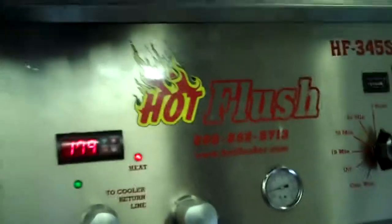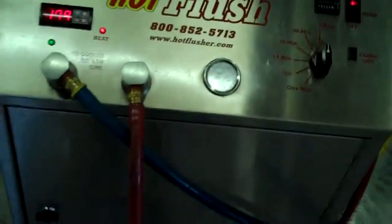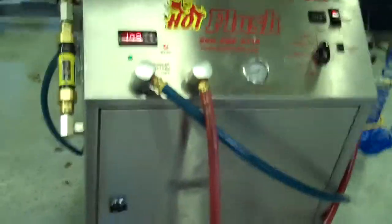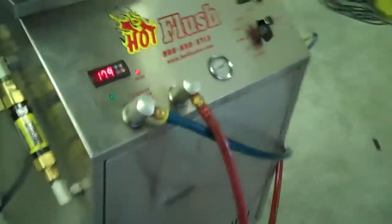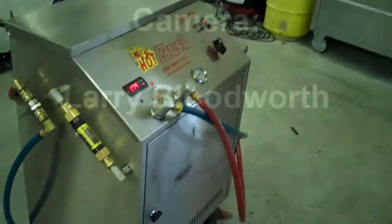Let's see if I can get a better shot of that. Where that orange line is — that's right at five gallons a minute. It's heated fluid and it gets all that metal and clutch debris out. This is a state-of-the-art machine; it just doesn't get any better than that. That's the hot flush machine, and that's what's going to be hooked up to your car to get all that contamination out of the cooler.